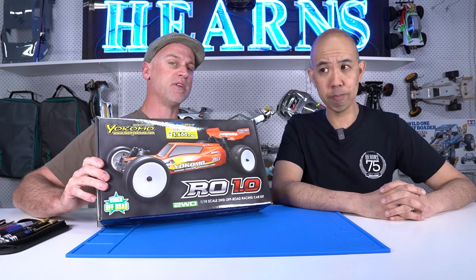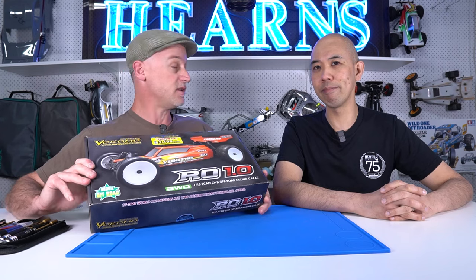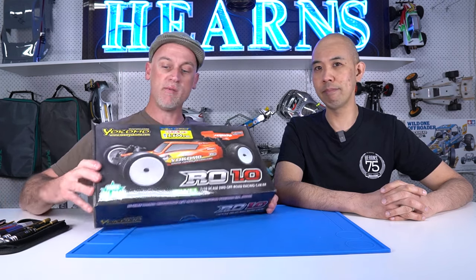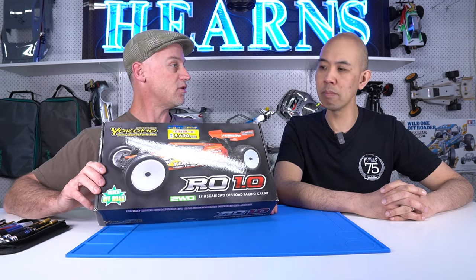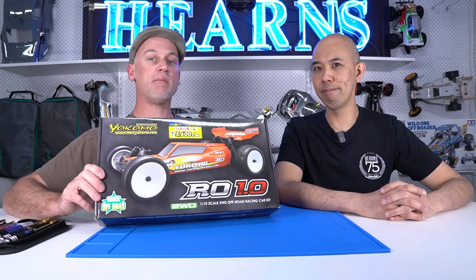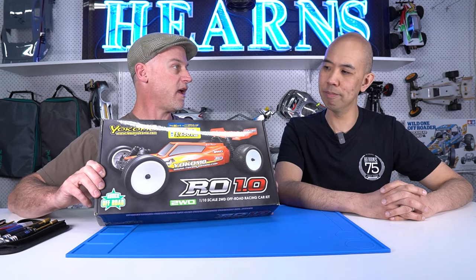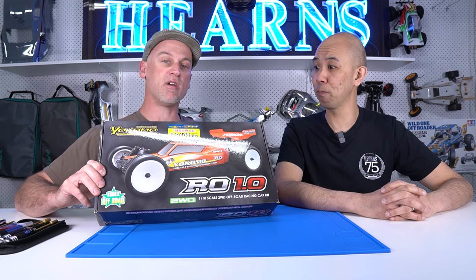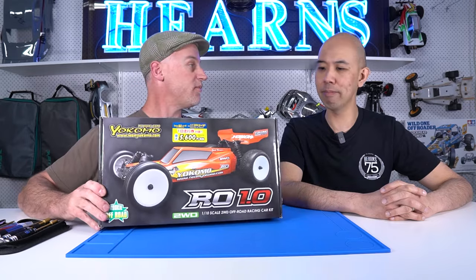And by rookie, they mean more of an entry level. That's right. Entry level, beginner style. And we just thought that we'd do it, and we're actually going to take it to the track, and we're going to race it, and we're going to do an old school build, and we're going to see if we can do it with a 540, a 27 turn 540 Johnson motor. Yep. We're going to put a 9-step speed controller in there, some really basic hardware. We're going to put just a metal gear digital servo in there. Yes. And an entry level FlySky radio. Let's give it a go. And we're going to go racing. That's it. With the Yokomo Rookie Off-Road. So join us as we start episode one of the build.